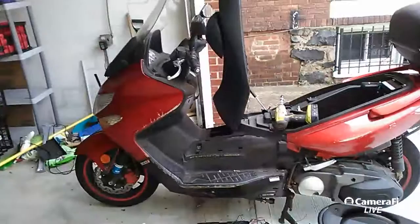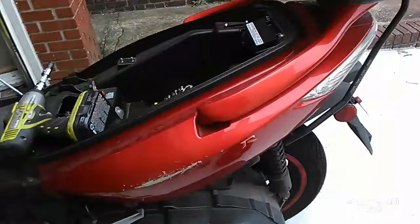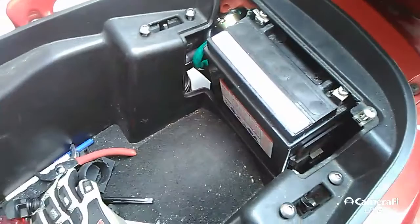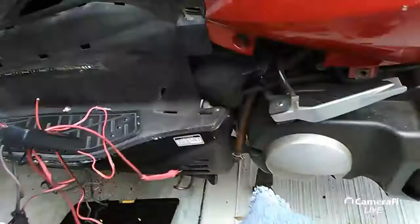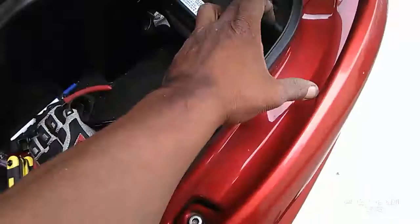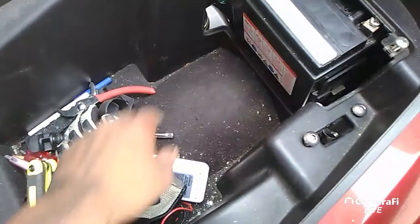So this is what I found. The process started with the battery — when you try to put the key in the ignition, the battery just turns it over and the spark gets hot. I had to take off the seat cover. We had a junction of wires in here and some of them were live, killing the battery. Also, the battery terminals had corrosion on them, so I had to take this off to get directly to the starter so I could jump-start it and see what was going on.